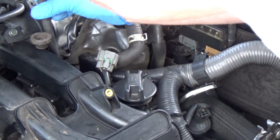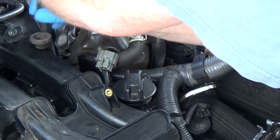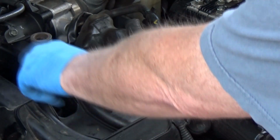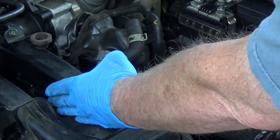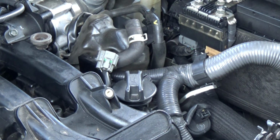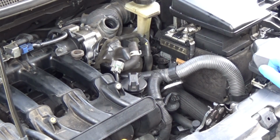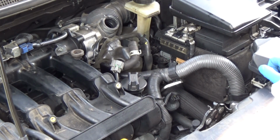All right, so what does this tell us? It tells us I'm in trouble, man. That's what that tells us. So we could have something wrong with the valves on this particular cylinder. That's bad. After I review the video, I will know, because it'll tell me if it's piston or valve. I suspect it's a cracked head. That's really what I think it is.